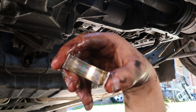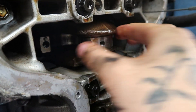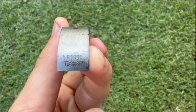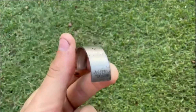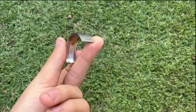The crank feels perfect — you can't even see any marks on it, so I think we're good. We got the rod cap off and as you can see it says STD, which means standard — not sexually transmitted disease. So that confirms these are the standard rod bearings, which is one of the three sizes we purchased.